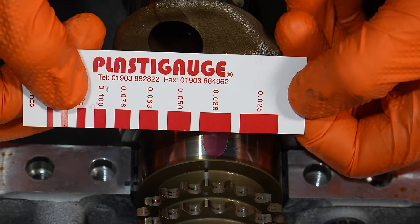To do the rear main seal I need to take the engine off the stand, which is tricky at this point because it's quite heavy. I put the block on the table. Be very careful not to damage the seal. I'm going to grab the old seal and use that to drive it in — this one also needs to sit flush with the inner lip. The pilot bearing needs to go in here a bit later for the manual gearbox. While we're here we can do the screw plug for the main oil gallery with a brand new washer.